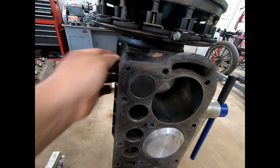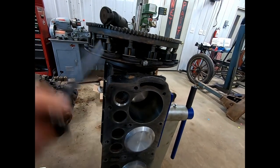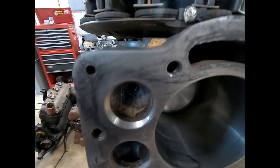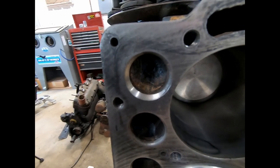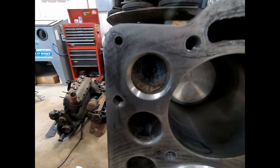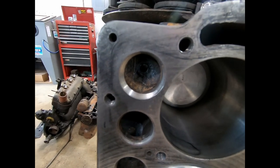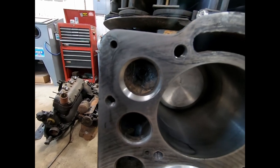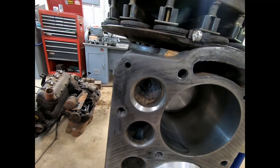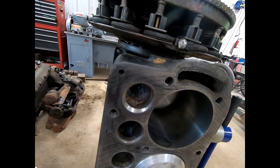So I took a valve grinding stone, stuck in a guide for the stone, and did it. And I don't know how well, it probably shows up worse on camera. But as you can see, they've reamed it crooked, and the valve seat is not round. Okay, see how it's wider on one side than the other? I just touched it with the stone. So somebody had really gone to town on that thing.